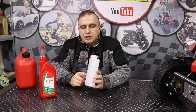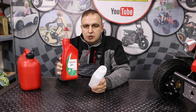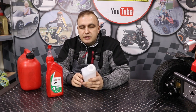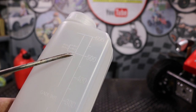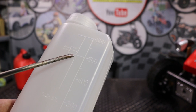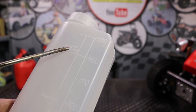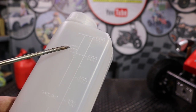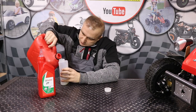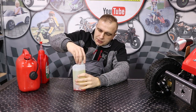With the quad you will receive the mixing bottle. You have to mix the petrol unleaded fuel with two-stroke oil for motorbikes in the ratio 25 to 1. On the mixing bottle you will find a few lines. You have to add the fuel up to this line here, and then the second one here — you can see the small line, it says 25 to 1. Then you top up oil up to the second line just here. Next, close the bottle and shake it well.